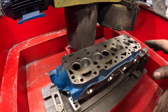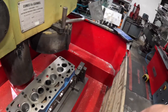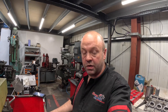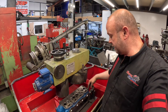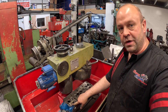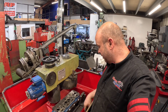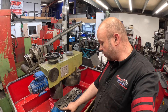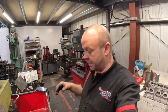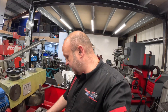So I've just bolted the cross flow cylinder head down and you can see that it's skimming like this, which would normally say that the setup of the cylinder head on the machine isn't quite right. So what I've done is measured four points of the cylinder head. And I think what's happened is at some stage before, someone's given it a re-face and skimmed it on the angle a little bit, because this is definitely high here and here, and this is still low. So I'm going to take a couple of passes off it and see how many thou bring it in and then have another measure up. If that's definitely previous machining, that isn't very good at all.